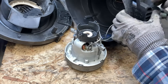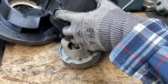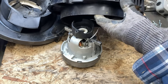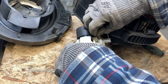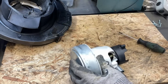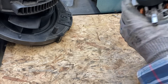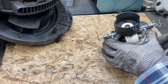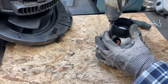Let's get this wire off here. I'm going to be very gentle with these because sometimes the staked-in spade connectors come off as well. That's no good. Let's have a look at this. It should lift out but it doesn't want to — it's welded in. The commutator bar has been on fire. The brushes are cooked, but it doesn't make sense because it shouldn't be so bad.